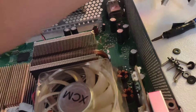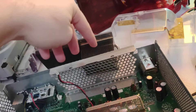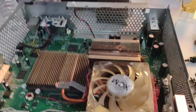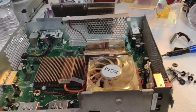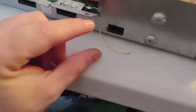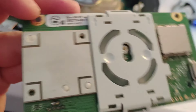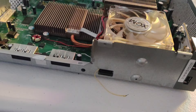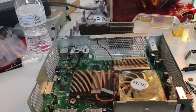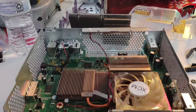This side goes into the DVD drive, and this little plug in there is where that goes to power the fan. We've got the blue Talus Moon fan - so it'll be blue Talus Moon fan, white fan shroud, blue XCM fan, blue and white DVD drive, flashed. There are lots of little wires and stuff going on in here because there's a lot going on. Got this fed through - it's time to solder or feed that through the bottom of this, which is a big pain, then solder it onto the bottom of the button. That's what tells it that it's been pressed to activate the sounds. Mount that in place, turn it on real quick, test it out, make sure it's the blue fan and the speaker works.